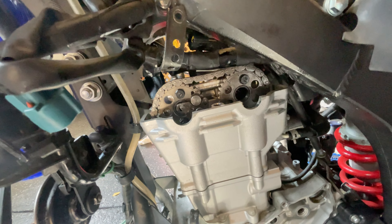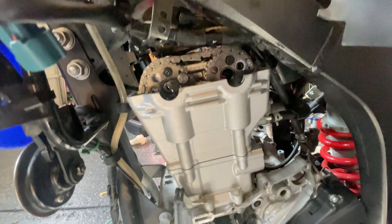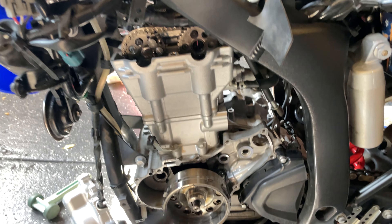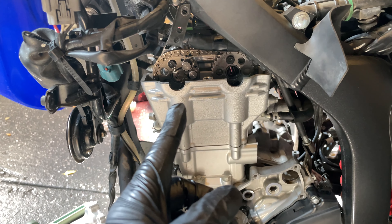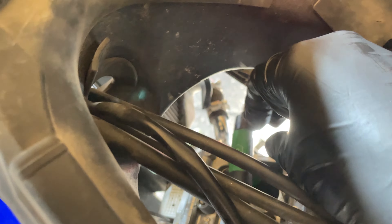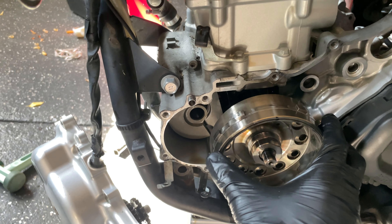Here's a diagram of what's on there after the flywheel comes off. This is your crankshaft — there's a little rectangular piece and a gear here with a bearing inside. You want to wedge something underneath to pull that little piece out, then you can take the gear off with the bearing and access your timing chain behind it.